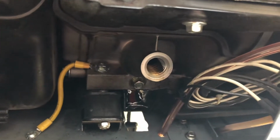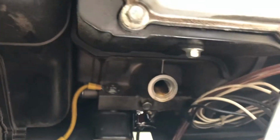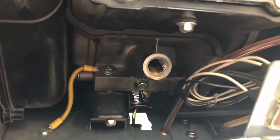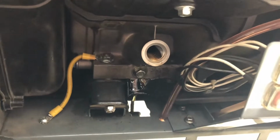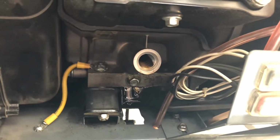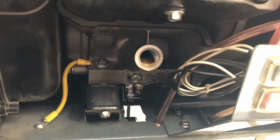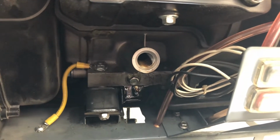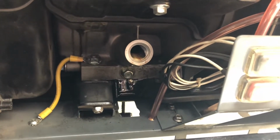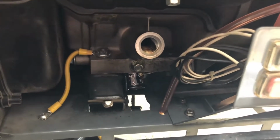Okay, so it did overflow. So it's running back out of the filler tube. And I still have the drain pan down there, thank goodness. But I only got, what did I get in there? I got 18 ounces in there. It's supposed to hold 20 ounces, so maybe it had some left over. I don't know. Or maybe actually the RV is leaning a little bit. So I got it up on a block on one side so that the water in the fresh water tank will drain completely. Alright, so yeah, you know it's full if it starts running out of your filler tube.